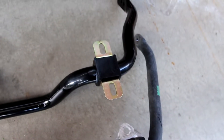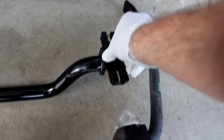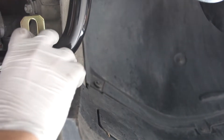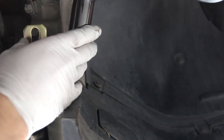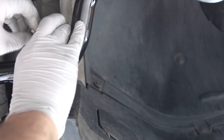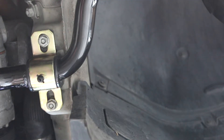There's the stock one — here's the new one I'm about to put in. The bushings are the same as they are on the rear: just half a tube of lube on each one of these little bushings. And then I've got these little spacers — they're supposed to go between the body of the car and the bushing. I think it's just because there's a difference in the height of the new bar versus stock. Not entirely sure why they're included, but they just go there like that. Then we just put the whole thing back on, send the nuts in, and hold it in place. The spacer just goes between the car and the bushing, and once they're both in, just tighten them down.